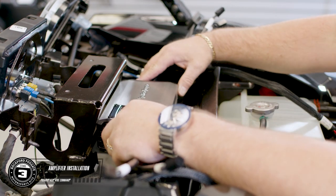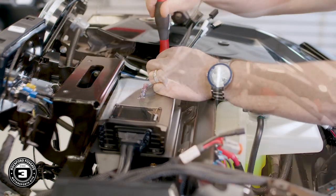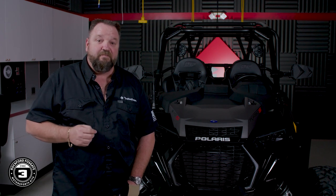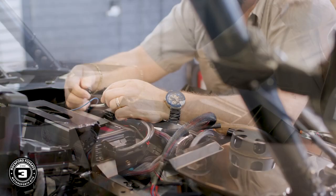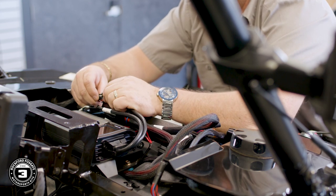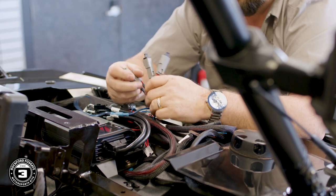At this point you're ready to mount your amplifier using the provided hardware. Now you're ready to wire your amplifier. These new M5 series amplifiers are equipped with our new preset technology as well as pigtails for your connections. Start with your output cables: your front goes to the speakers, and your rear output goes to the subwoofer. Connect your power plug. Then move to the input from your Ride Command harness — plug in the front to the pigtail labeled front, and the subwoofer to the pigtail labeled rear. Now connect the blue remote turn-on wire. Match your speaker locations to the proper cables and attach.